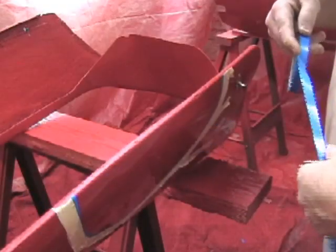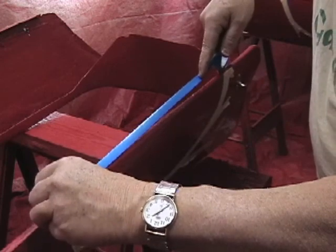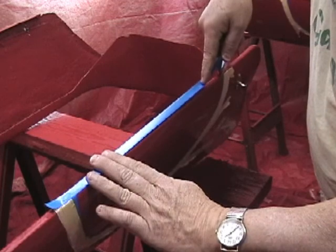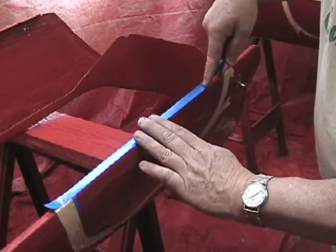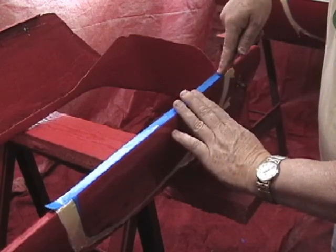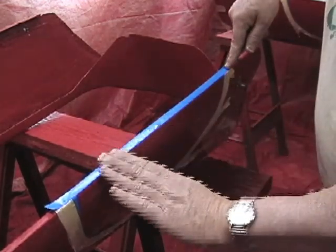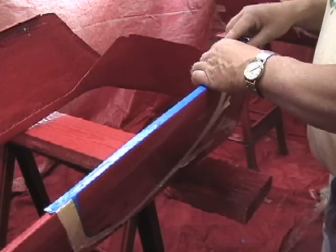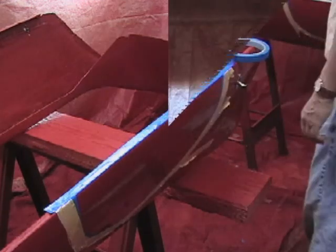Okay, now we turned over the main cockpit section so that we can work on the underside of it. And we need to make a very straight edge where the number circle's gonna join the under tray. Again, not only is it to give a nice crisp edge, but if we don't make a seal here, the entire underside of the body will get white overspray on it.